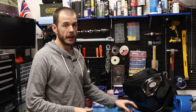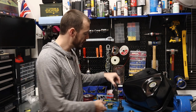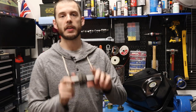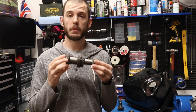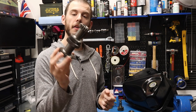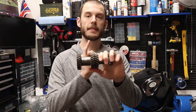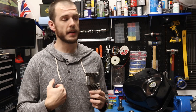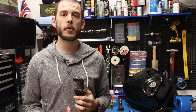And then finally, one of the most expensive parts I've purchased for this build so far is a new gear set. This is a brand-new cast gear set made by Mini Spares — it's called an EVO heavy-duty gear set. It's still helical because I don't want straight-cut gears in my gearbox. They're loud and obnoxious in my opinion, and while they do have great performance benefits, I don't think that they're suited for a road car.